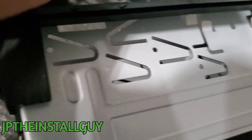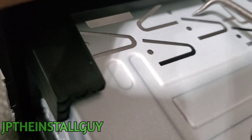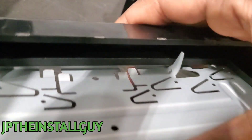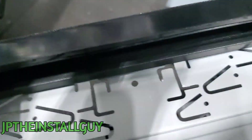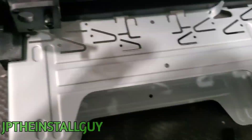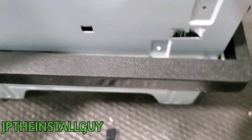Continue pressing the tab up, doing it at the one that's closest to the dash kit. See how we're pushing it at the top and it's not going anywhere — that's what you want. Do the same thing to the bottom side. Flip it over; I like to take my finger and push those little tabs in to make sure it actually snaps when I slide the CD player in from the top.